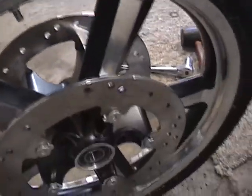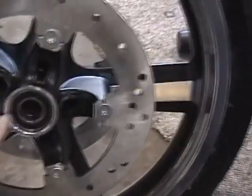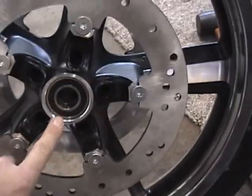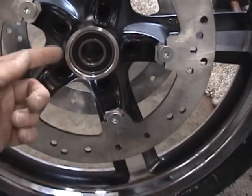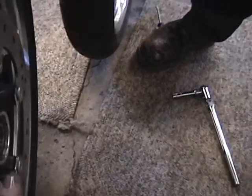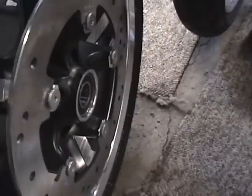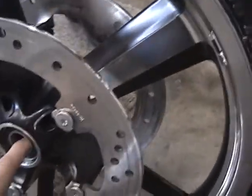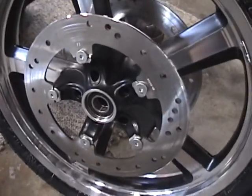Now down here on the wheel — tilting this back a little bit — being that this is the primary side, this is where the wheel bearing kit actually stuck out past the wheel by 60 thousandths. With that sticking out, even though it was down, it wasn't making up the slack that the sleeve needed. When we pressed the other side, it bottomed out and wouldn't press up against the sleeve on the inside.